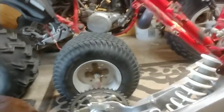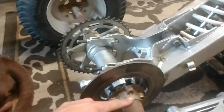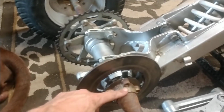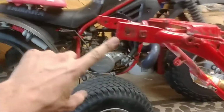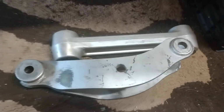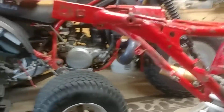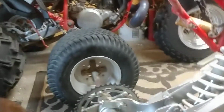Now I need to compensate for that inch, right? So it was at 17.5, no static sag. So no static sag with this, you're going to find, is 19.5 inches. And you're also going to find the same figure with the other setup. So you go up, sorry, from 17.5 you go up 2 inches, and then you lose an inch in your tires if you run 20-inch tires. Now you're up an inch.